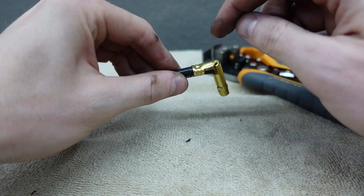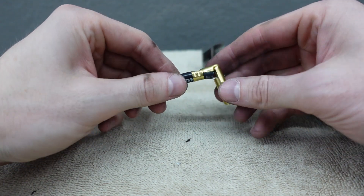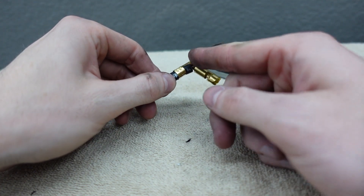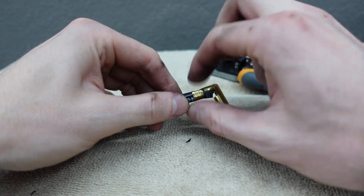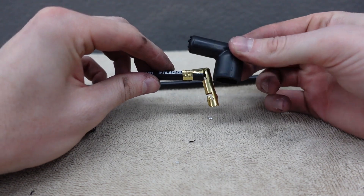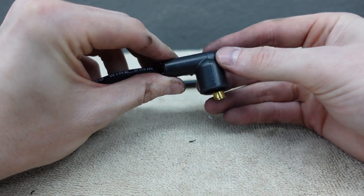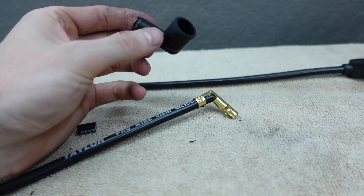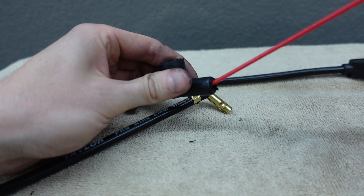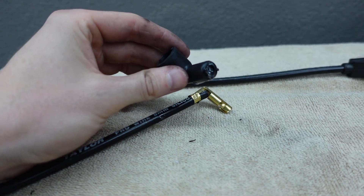There's a nice solid connection, and this crimp is going to help push those fibers onto the metal terminal which gives us a really good connection. Make sure those fibers are folded under and this is crimped on. Now the next challenging part is getting this rubber boot over the terminal. The instructions say you can use some WD-40 on it to help it slide in a little better, but this is going to be mildly frustrating — so let's give it a shot.